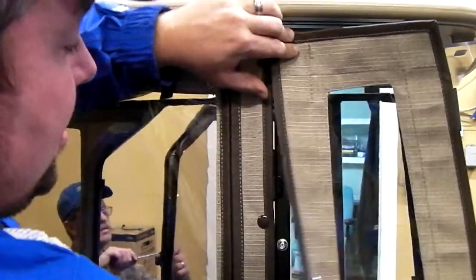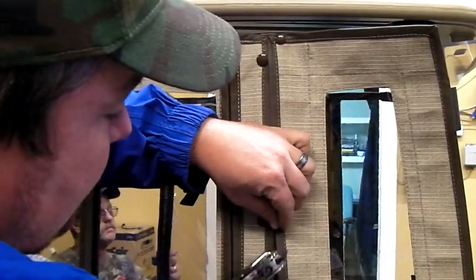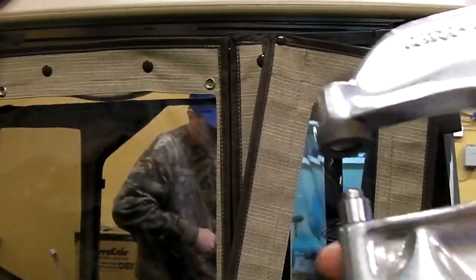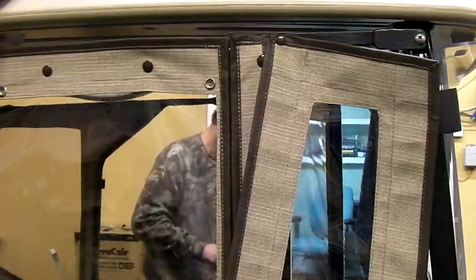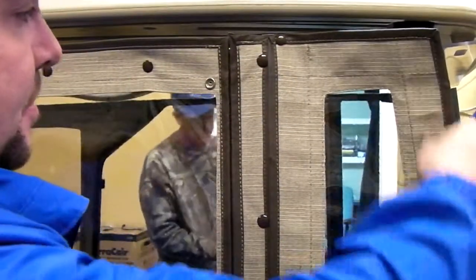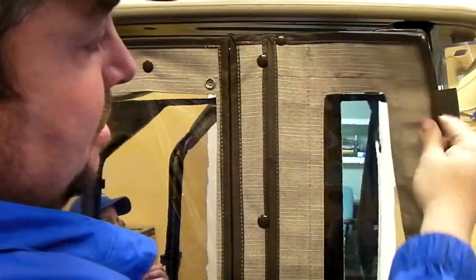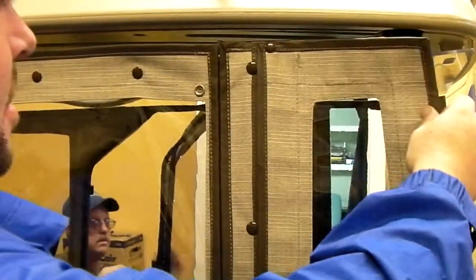I just started this one right here. You've got to put the snaps on — this is where it gets kind of tricky, but the factory snaps are right here along here. What you've got to do is go down and mark these. You need a couple tools — one of these steel ones, and this is a snap cap. They have different variations; I spent $130 on it and it works great — I think it's called the Press and Snap. I put the back ones on first and then stretch it back. Once it's tight, I stretch it back this way. Another thing you've got to be careful of is when you do it around the fold-down windshield — you want to leave enough room so the customer can unsnap it, put their windshield down, and put it back up. In the wintertime it's probably going to stay up 90% of the time and be fine.